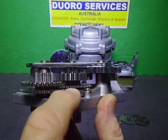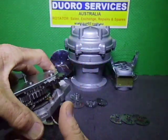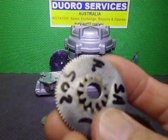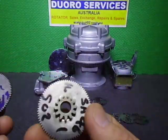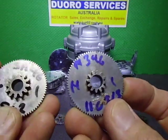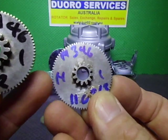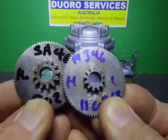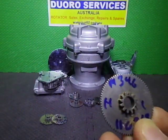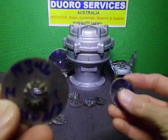So gear number one from the motor, number two, and number three in this drivetrain. First I'll pick up the 502 — this one here. When we compare the 502 to the 1102 and 1103, both the 1102 and 1103 run a smaller pinion, which already reduces rotation speed and increases rotation torque over the 502.